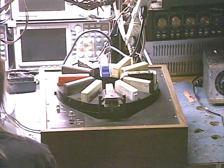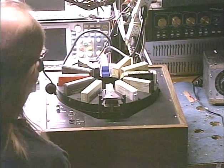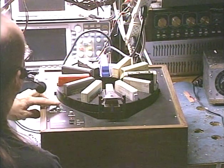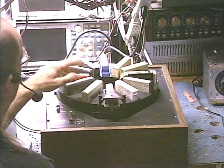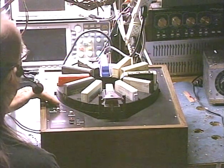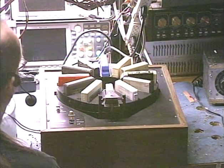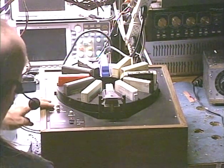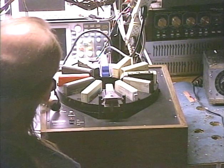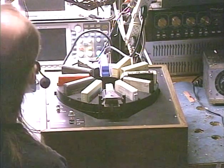Got some Bobby Benton here, and I'm just going to give a quick explanation. This top button here is labeled A1 and A4. In the top position, it'll switch cartridges after the fourth track is completed playing. Pressed down to A4, you can play the same tape all day long and it'll never switch — that's the only difference with this switch. This is just a stereo/mono switch, which would normally be kept in the stereo position.